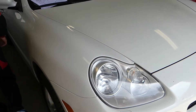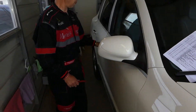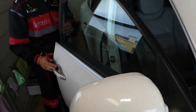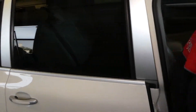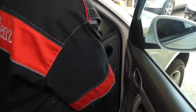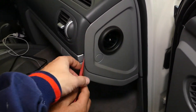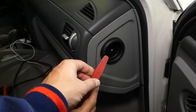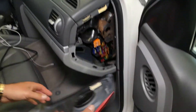Now, what you need to do if your rear right window doesn't go up or down — open that door. Right here you have one cover, and under that cover you have fuses. A plastic panel removal tool is really convenient and you can pop that thing open. It has five clips.